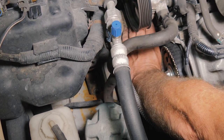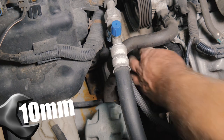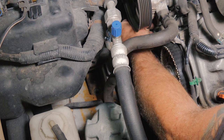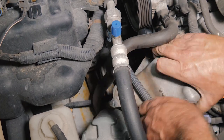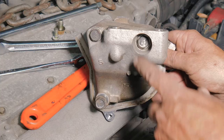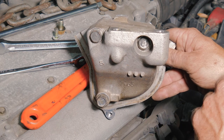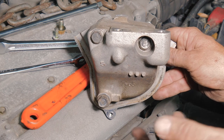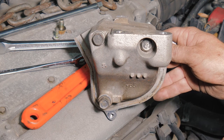We have something else connected here. Look, there's a 10 millimeter bolt on the top there. All right, so this was that bolt that was running into the motor mount. You've seen how we wrestled. Anything easier than that, you would just have to start removing the computer and the fuse box and laying everything off to the side. You are able to do it with a little bit of wrestling, but these are the three bolts that hold the lower mount for the motor mount.